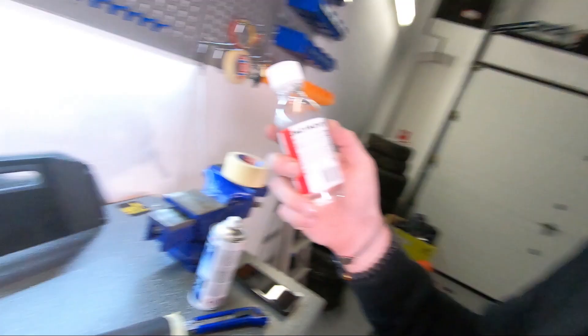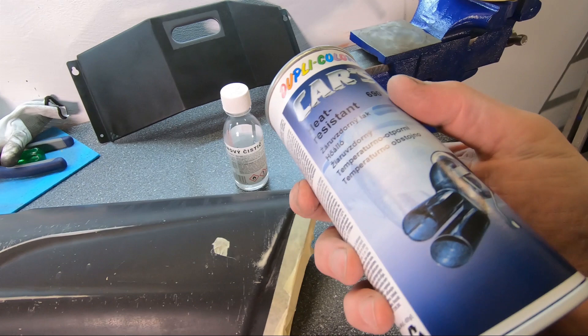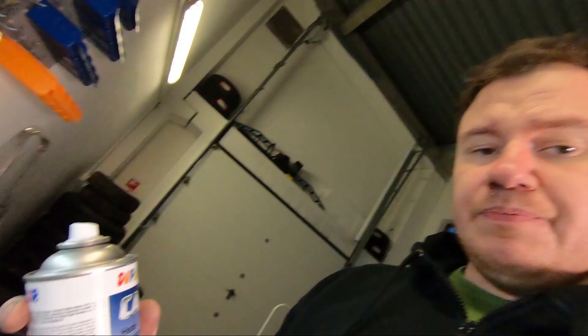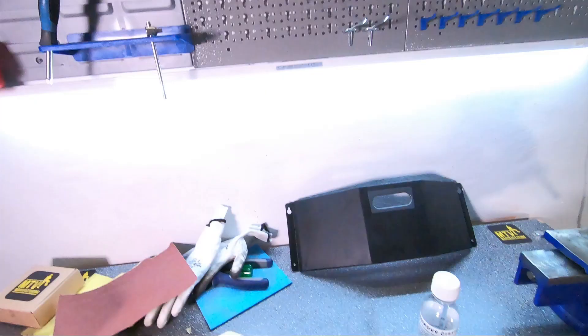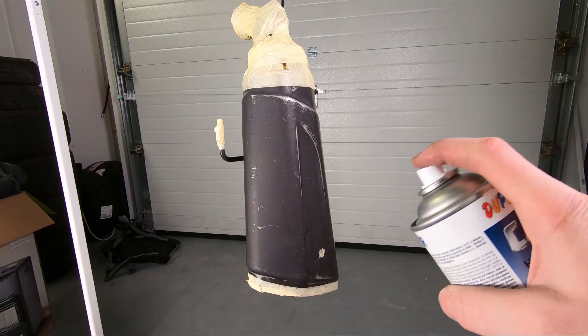We will apply one more time this technical alcohol — it's a degreaser. Then the last thing is this black matte coating, which is heat resistant up to 600 degrees. My top tip here — I'm not skilled and I've never done this before, but I have an extra metal part from a brand new heater here, and I've applied the black coating on that first to test it. I'm quite happy with the outcome, so now I'm feeling a little bit more safe. Let's apply the black coating.